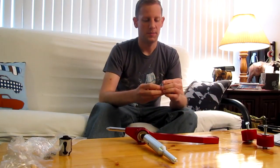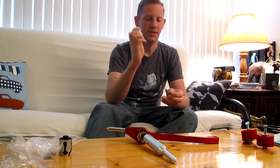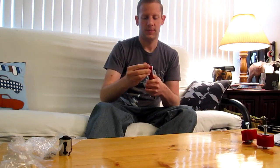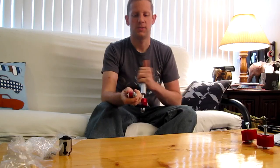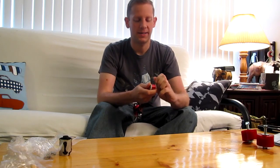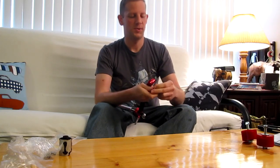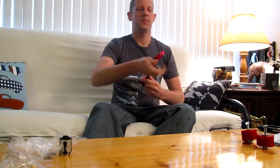Next thing we got is from Turner Motorsports. This is their Delrin shifter bushings. These go in the front of the shifter here. Get one here like this, and then the pin goes through. This supposedly makes things really solid and makes the shifting more precise. Normally there would be a rubber bushing in here that has a little bit of flex in it, so this gets rid of that. And also, like the transmission bushings, these hold up longer than the rubber ones. So that's a nice upgrade.